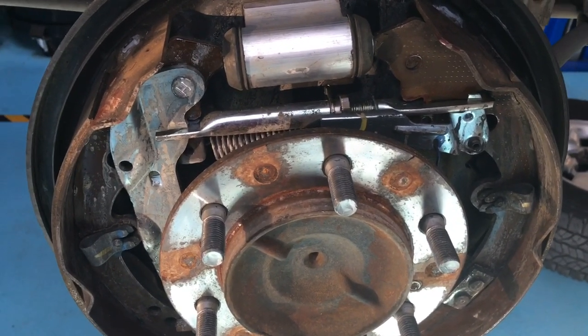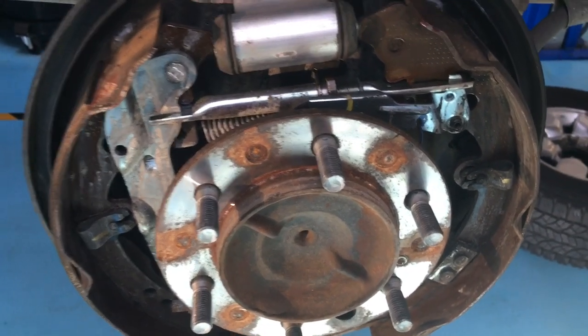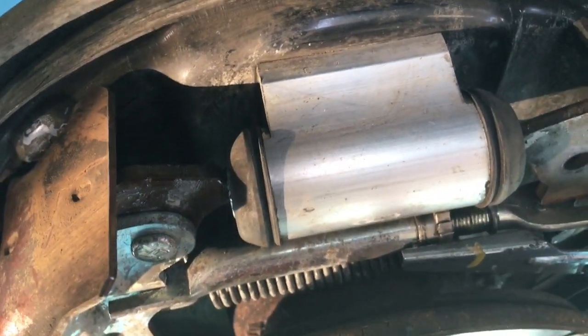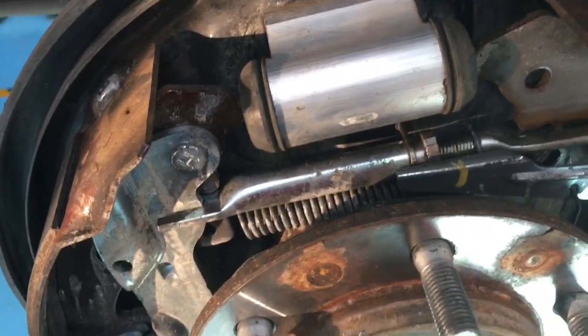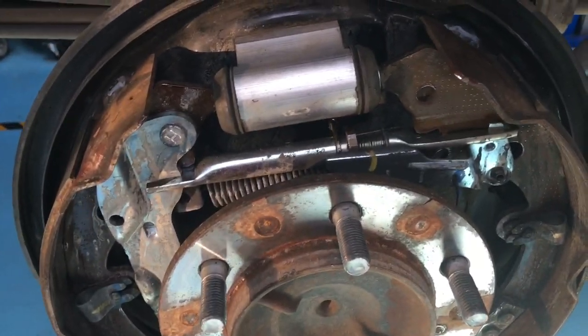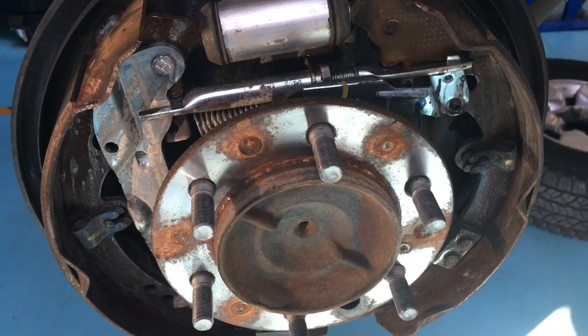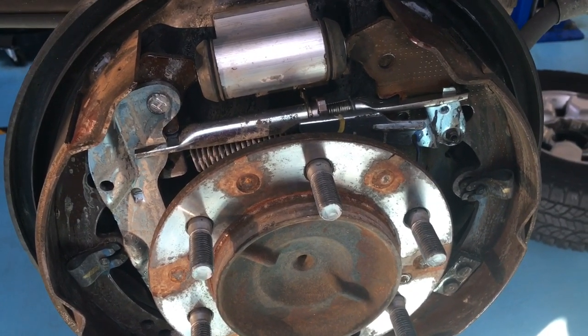If this is starting to sound too technical, take it to someone that knows what they're doing. As for getting the axle out — it's always advisable to drain your diff oil first so that once the axle's out, oil isn't leaking everywhere. You've got to take off the wheel cylinder and cap the brake line — it's steel here, no flexible hose, so have caps ready. Always take the ABS plug and ABS sensors out first as a good habit, because on some vehicles the sensor can get hit when things are coming out.